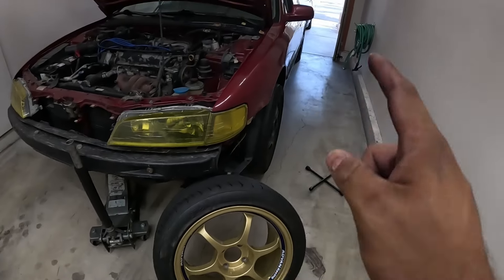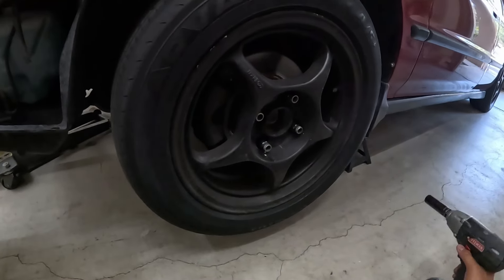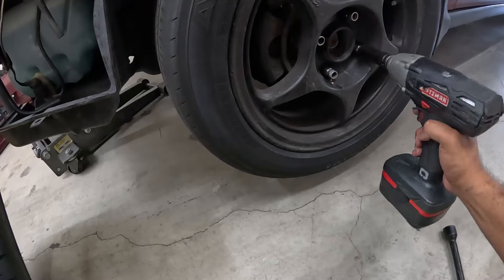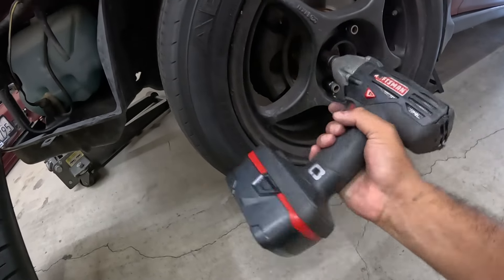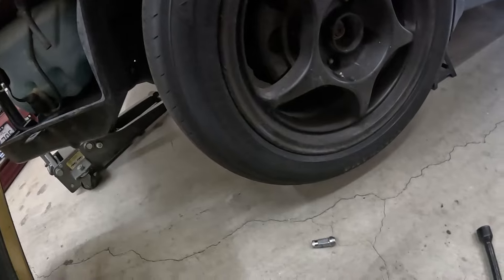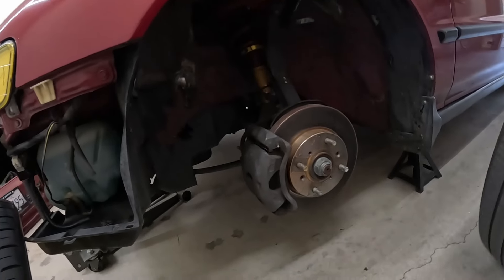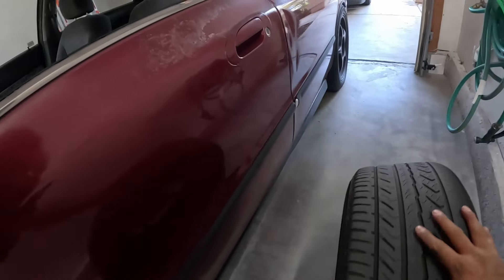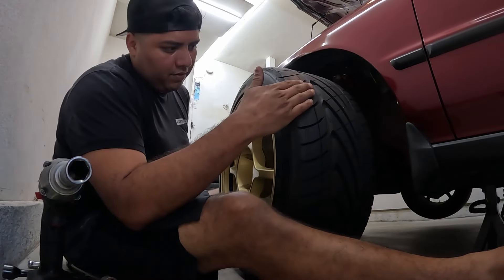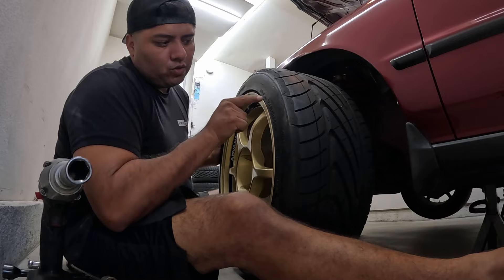The gold and the red — or what's left of the red — will look good. Man, this side was super over-torqued. Who did that? Of course it was me. It was extremely over-torqued, the other side was too loose. Hopefully we don't run into any issues with the lug nuts not fitting the wheels. To remind some of you core owners: 17 by 8 and a half, plus 37, tire 225/45.